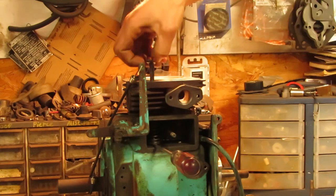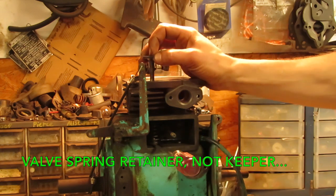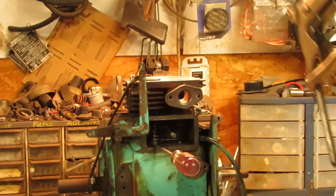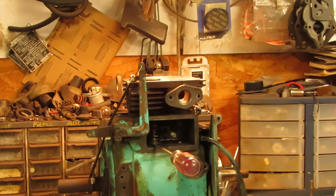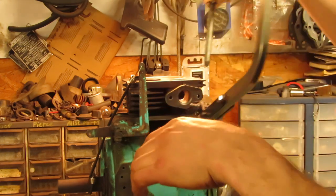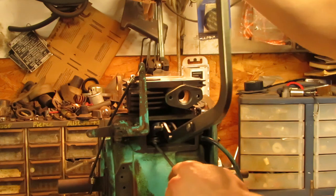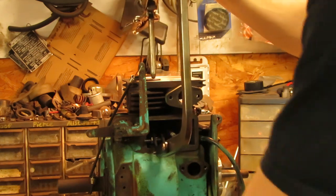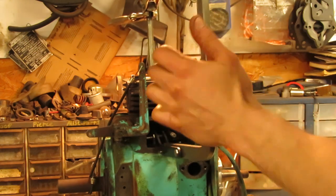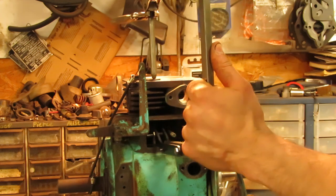So what I went ahead and did is I put my valve spring and my keeper inside of here, and then I can set my valve down inside. Now I know, unfortunately, you guys won't be able to see that much from there up close, but it'll be better than sitting on the side of the bench over that way where I had you before. So I just keep the screwdriver underneath the keeper, that way I can get the fork underneath there on the valve spring compressor.